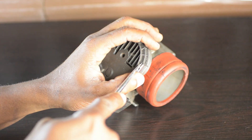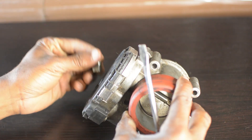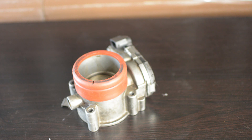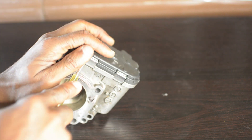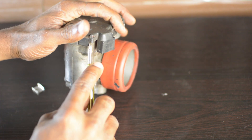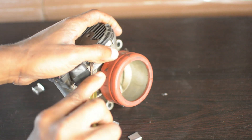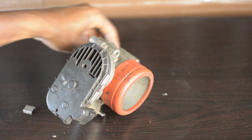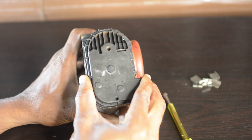This is the throttle body and I'm trying to open it with a screwdriver. You have to be very careful and use a very thin screwdriver — I tried a regular one and it didn't work, so I had to get a tester screwdriver. This throttle body comes with six clips. These metal clips hold the sensor in place to the body of the throttle. Now I'm about to pop out the last one.